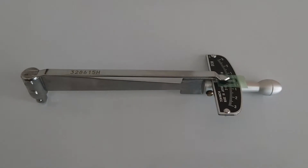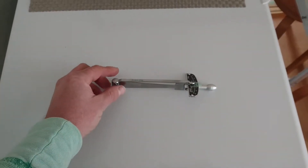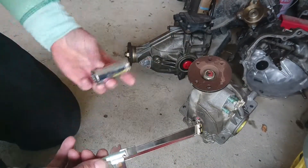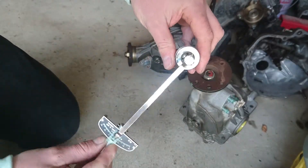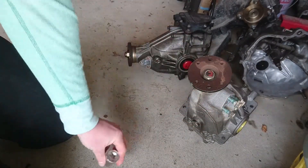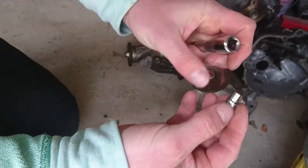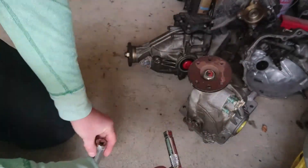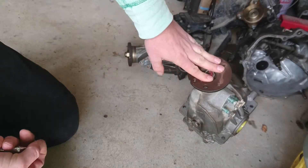One of the problems is if you undo this bolt, then you have to do the bearing preload. To do that you need a torque wrench that will measure between 0.5 and 1.5 newton meters — so I bought one. Whatever front diff I end up using, I'll overhaul it, which means doing the bearings and all the seals. To set the bearing preload you need a special torque wrench — this is the one I bought. But it's tiny — it's a size 22 and I don't have a 22 in this series. No dice. So how am I going to get that onto here? I don't have an adapter, and I've never seen them make an adapter for this. So what I'm going to try and do is get this and a quarter inch — because this is Japan and I'll never need this — and weld it in there if I can. That will make this into an adapter that can go onto there, and then I'll be able to set the torque preload on this bearing.